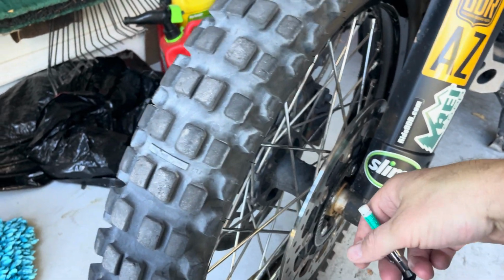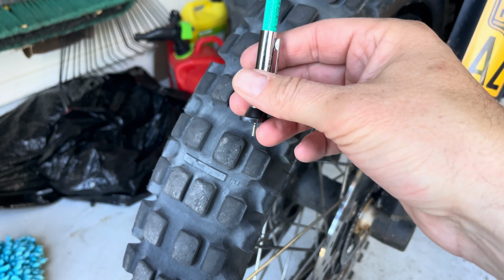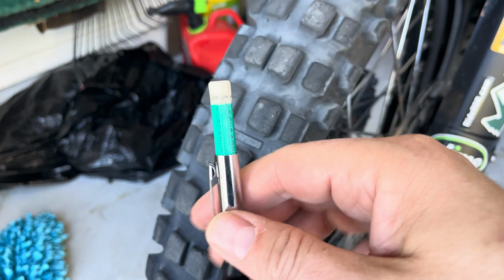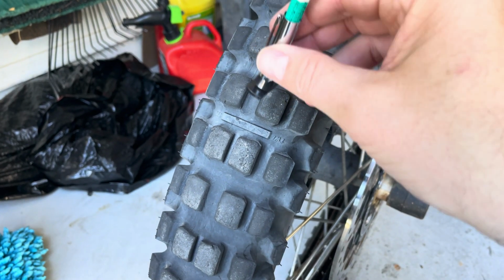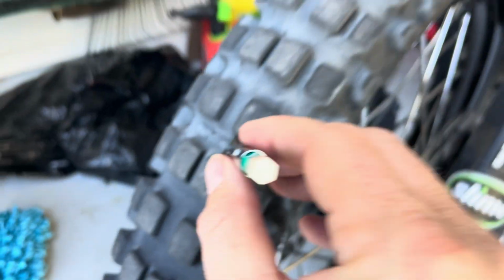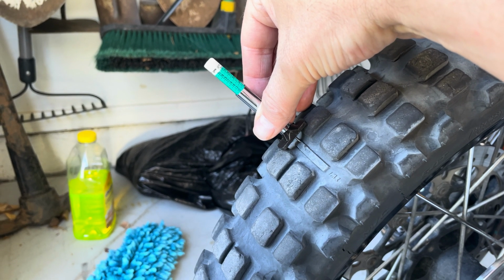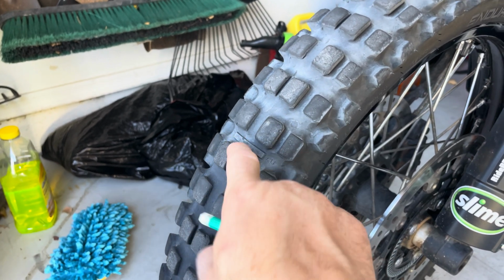The mistake that some people make when they're checking their tire tread depth is taking their indicator measurement tool and going all the way to the bottom where the tire is. So they're measuring between the tread and reading out a number. What you really should be doing is measuring your tread depth down to the tread wear indicator bar. So you take it, get an example here, and put your little plunger right on the tread depth indicator and then go to the tire level there. That will give you the correct reading, because you shouldn't be riding your tire beyond the tread wear indicator.